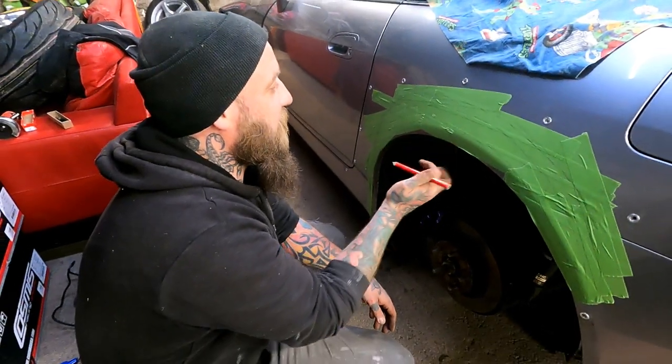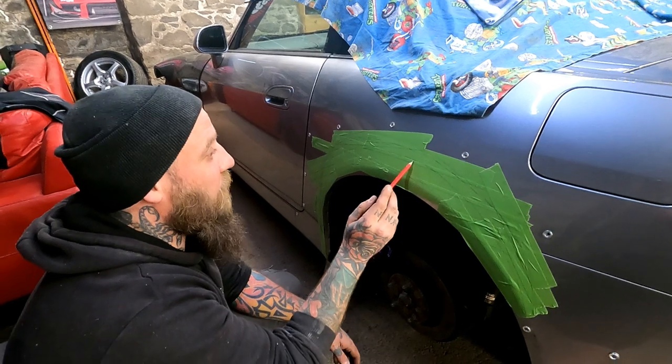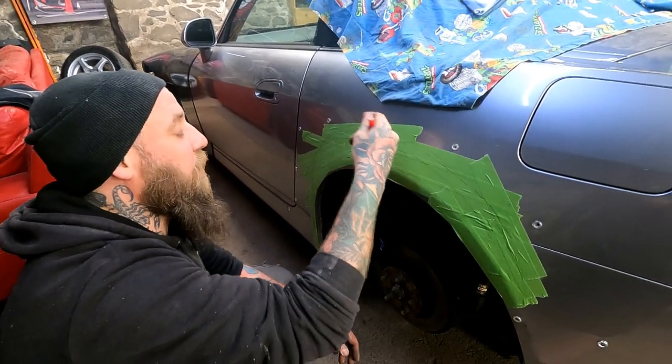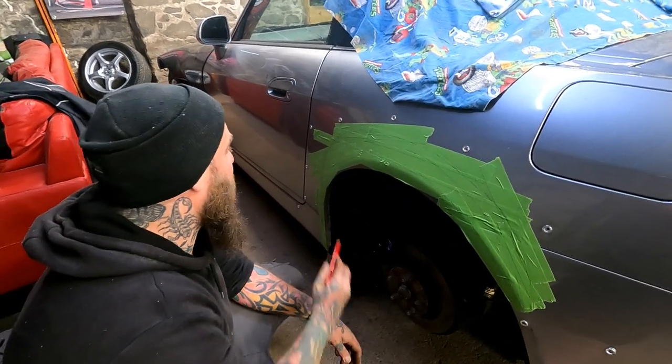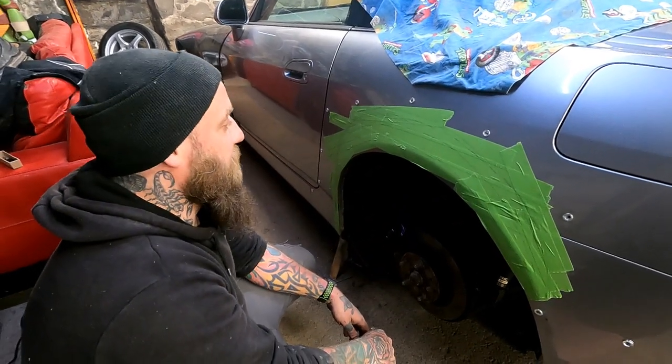So your inside skin, that one you go through both skins, basically. And then that one, the higher up one, you only go through one skin, and then you can fold up the bottom skin. You feather it, I'll show you all that anyway, and then weld it. So we need to get cutting through the bottom skin first. So yeah, it's grinding time.